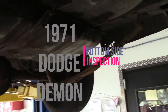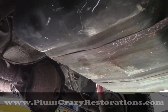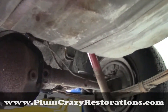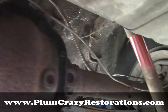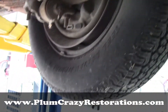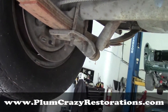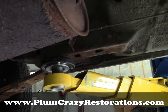Just having a look at the bottom side here. This car has been sitting for quite a few years, so we're looking at replacing the fuel tank and the fuel lines front to back. The brake lines all need to be replaced as well from sitting. We'll also look at all new wheel cylinders, front and rear brake shoes — it is a drum brake car all around.